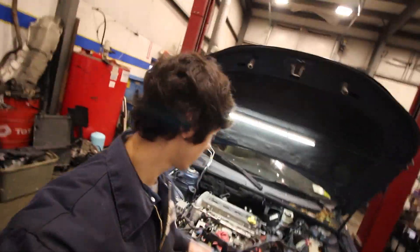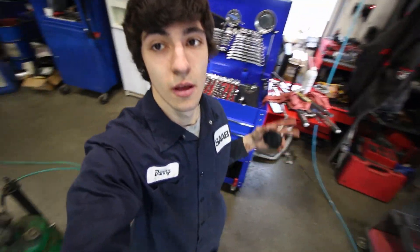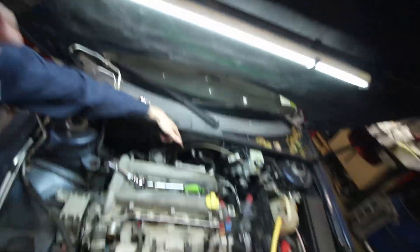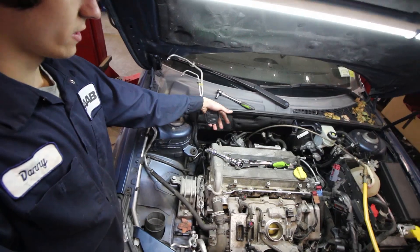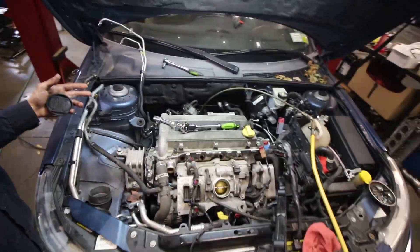Alright, we're back - still no haircut, it's only been one night. Going to take the cat off, take the exhaust off. Might be a little loud - making a mess. I got the cat off. Had to take the rear trailing mount, bend it and pull the cat down. I was just draining the oil here. About to take the turbo off. Then start taking the valve cover off, spark plugs - haven't gotten to them yet. This is all loose. It's going pretty good, actually.